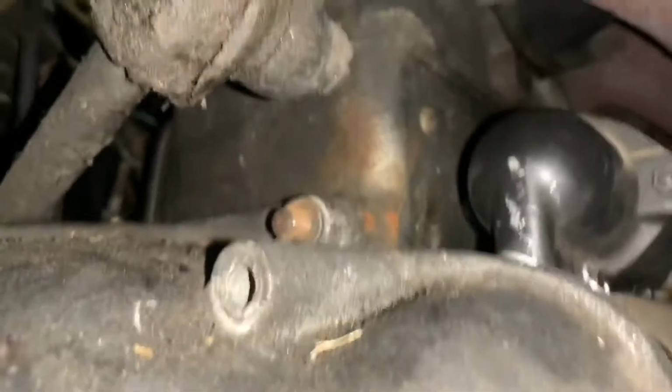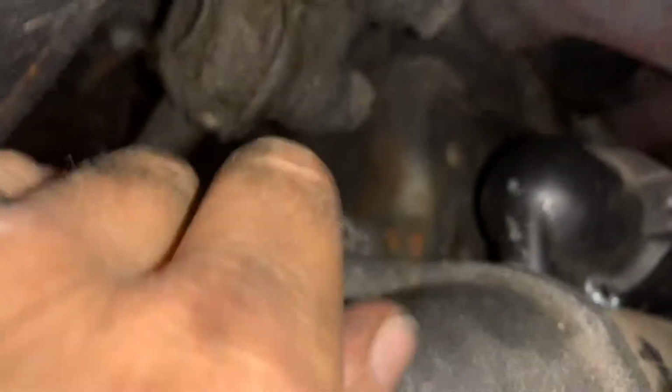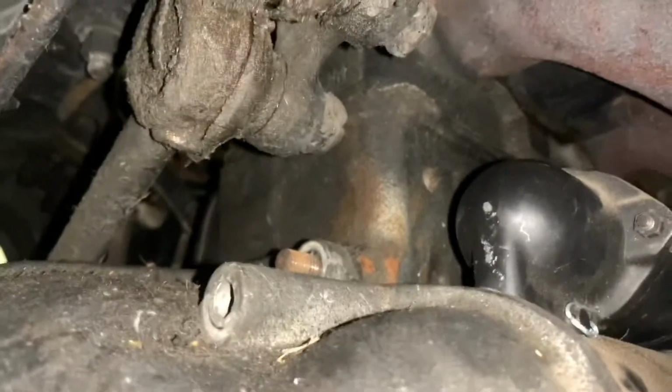The 2 starter bolts are out. The last bell housing fastener is a stud up there, as you can see. I finally got the nut off of it. Oh, they're smart to put a stud in there. How cool is that? It's like GTO quality there. Yeah, I don't know why, but it's there.